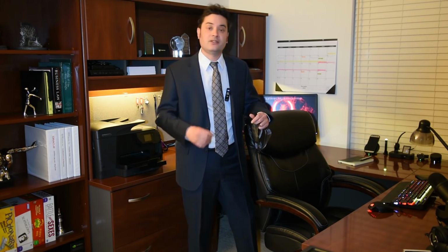And one other important thing to know about setting this up is make sure you get the right drivers. Update the BIOS drivers, and also if you're using the Samsung 950 Pro, or the 960s that are about to come out, get the Samsung driver. Windows automatically comes with the Windows driver. You want to switch that to the Samsung driver. It gives you so much more performance. Now, without further ado, let's take a look at the computer.